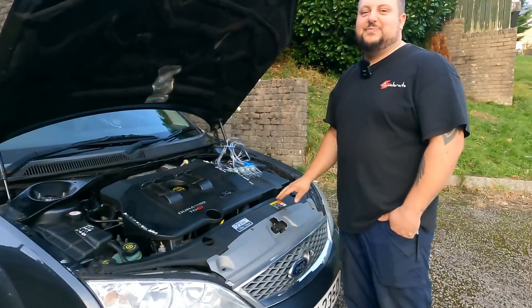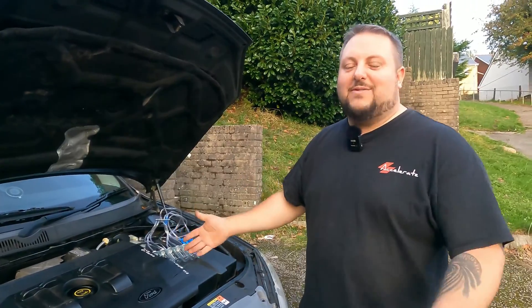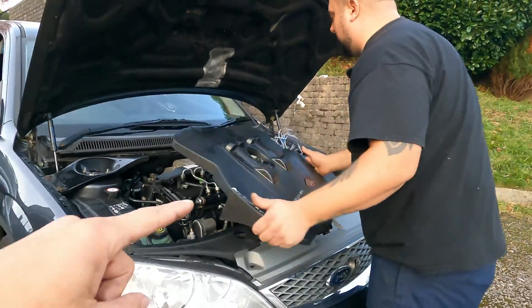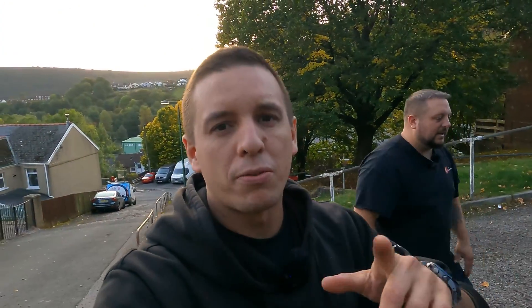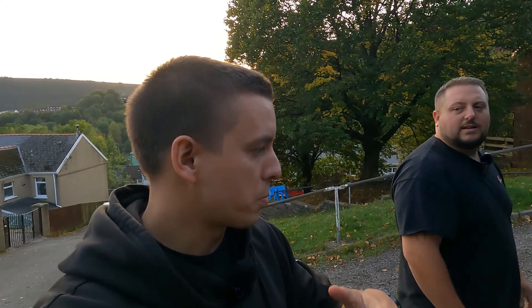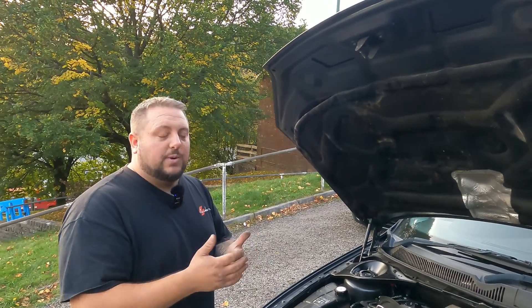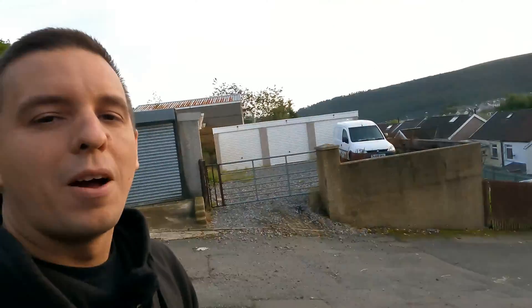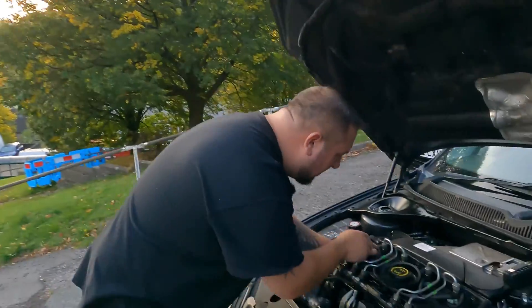This wasn't intended to be an instructional video, but take it as instructional if you want. Yeah, we're not mechanics, but we have looked into this — we know what we're doing with these, it's relatively straightforward. So first step: open the bonnet and take the cover off. We're going to run off Delphi's instructions, so the procedures we're following are recommended by Delphi. We'll put them in the description as well. Five minute test, 25 mil per minute allowance.